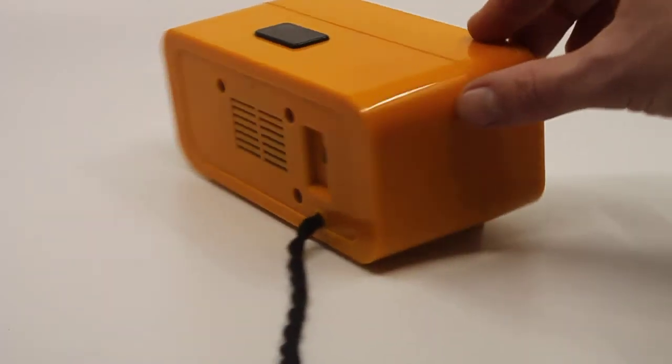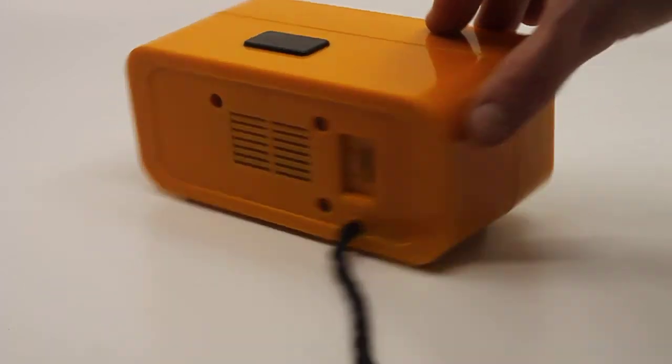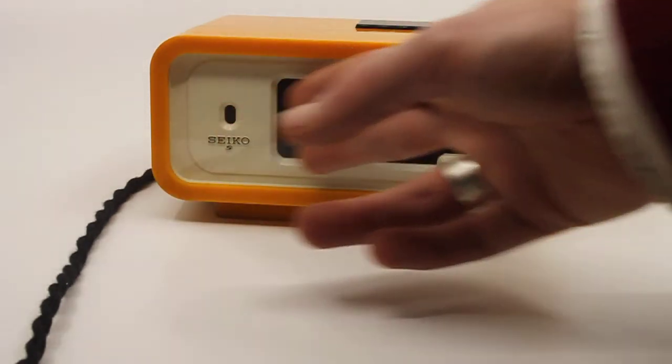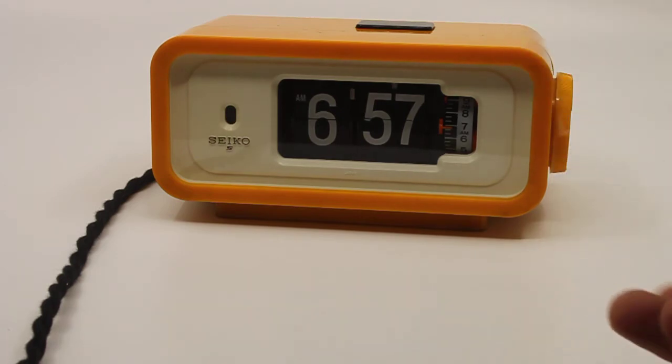There's no noticeable or mentionable damage anywhere, and it's in a nice condition. Of course I completely took it apart — this front was very yellowed and I brought that back to life, whitened it, made it white again. I used UV light for that and Salon Care — just google it — sort of a mix, a different version of the Retr0bright, which you can also find online.